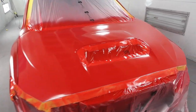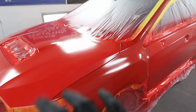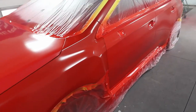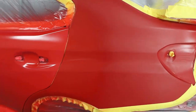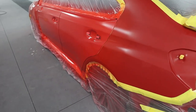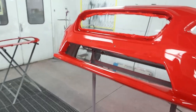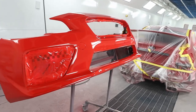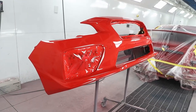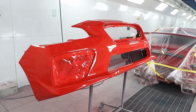This is my first time using P30R red sealer. I'm pretty excited about that — I didn't even realize that red was a thing. So I'm going to go mix up a little bit more of this, get another coat on this, and I'll bring you guys back. So here is that one coat of sealer. As you can see, fender to hood — it doesn't cover instantly. Same with the doors and fender. You can see where I kind of blended it out onto that. Anything that's going to help my solvent-based coat cover is going to be welcome. This bumper — this is after two coats of sealer. It's still not perfect, but that'll do. That looks a lot better than I was expecting. So I'm going to go mix base coat and let this dry for probably 20 minutes.